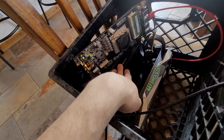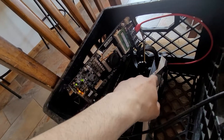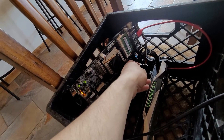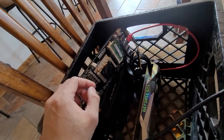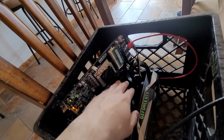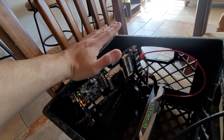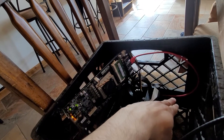This power supply is only 850 watts, but I am only using one card for now — this is a test rig. I have the SATA plugged into an adapter to do the 6-pin. I could also go straight with one of the other PCIe slots, but I wanted to save those for graphics cards. Really, that's all you need: the RebTech board, a flash drive, and a riser cable.